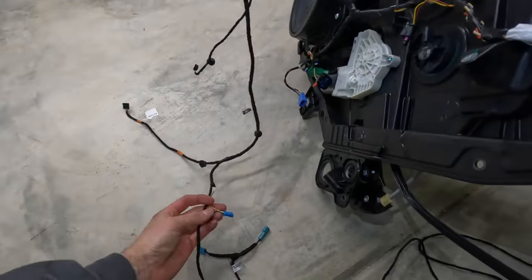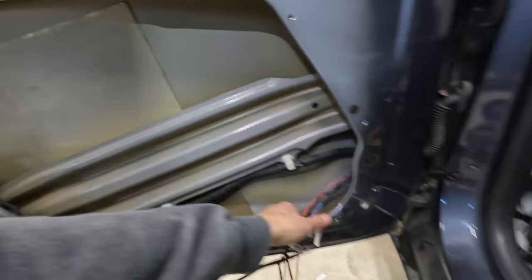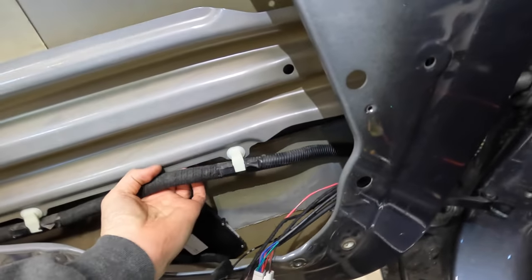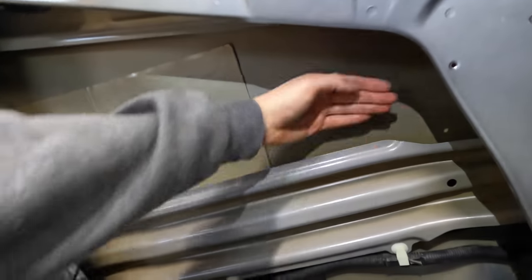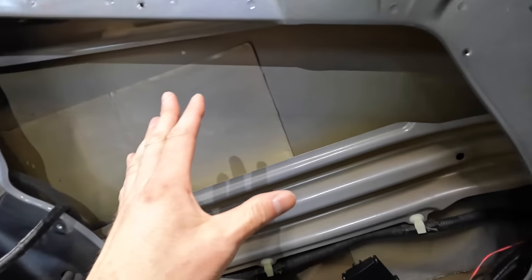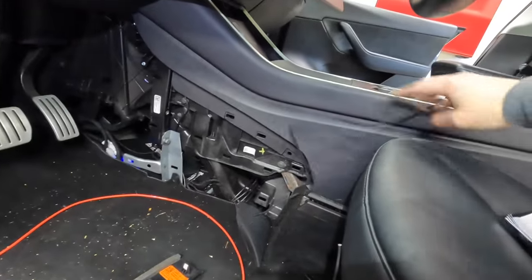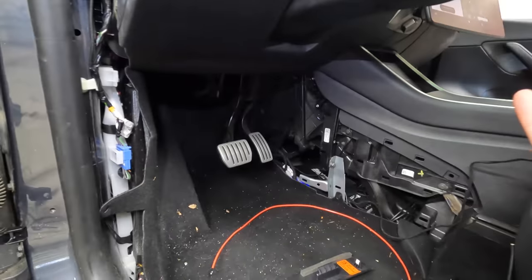This blue wire runs to make sure everything works. Tidy up the wiring — zip tie things together, put the controller at the bottom out of the way. Make sure nothing is in the path of the window. Tuck all wires as low as possible, then put everything back. I ran the button wire under here — I have one side working and now I'll move to the other side.